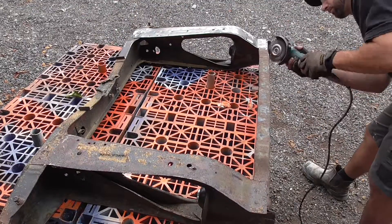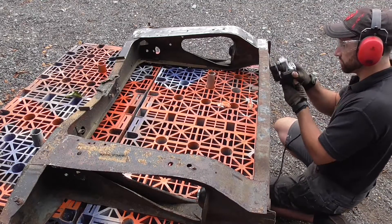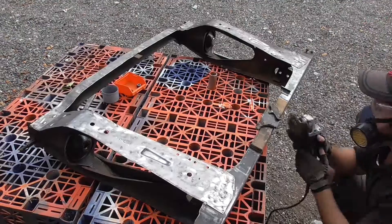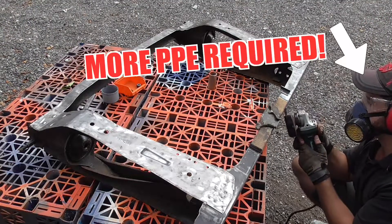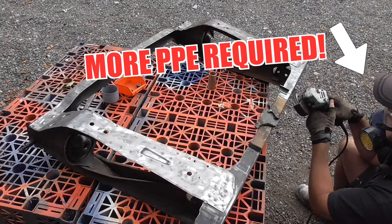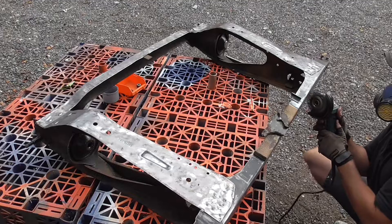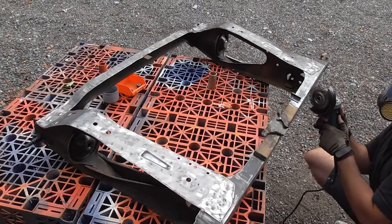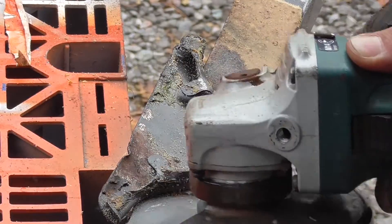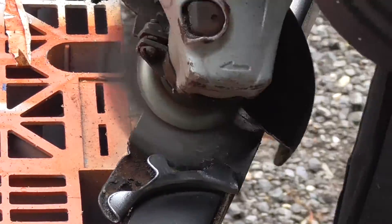As you can see I've opted to start with the rear subframe as this is already stripped down. Once this is in stone chip and drying I'll tackle the tear down of the front subframe before giving it the same treatment. You may also notice in this video that these subframes still have a lot of the original preservative wax on them, which is awesome, and I don't like removing originality, but there are one or two areas where the wax has flaked over the years and surface rust has formed. The only proper way to sort this is to completely strip and recoat the entire frame.